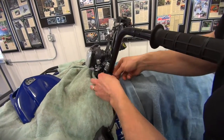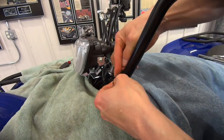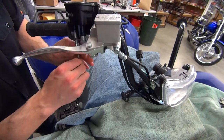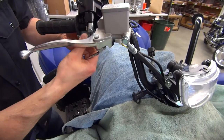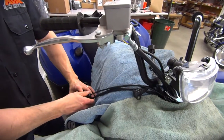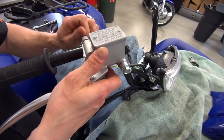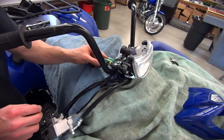Now there are normally wire retainers on here — like this one right here. I did take a couple other ones off already, but just take these off for now. Let's get this throttle assembly off and the brake lever off. There are two Phillips screws underneath the throttle assembly — I already loosened them. Let's take those out. Got the cap here, set that aside. Throttle simply comes right off. Two 8 millimeter bolts on the cap here on the back for this brake assembly. Now that we got those out, set them aside.